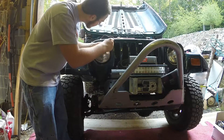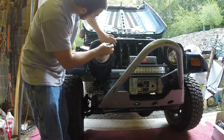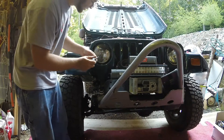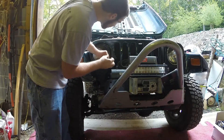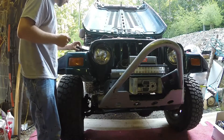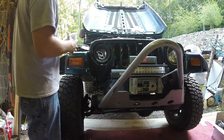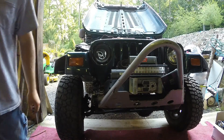For basic removal, use a T15 screwdriver type. If you don't have that, you can make a wrench work, but it's a little bit harder. You're just going to set everything to the side where you know what's what and remove the headlight. I'll just quickly repeat the same on the other side.